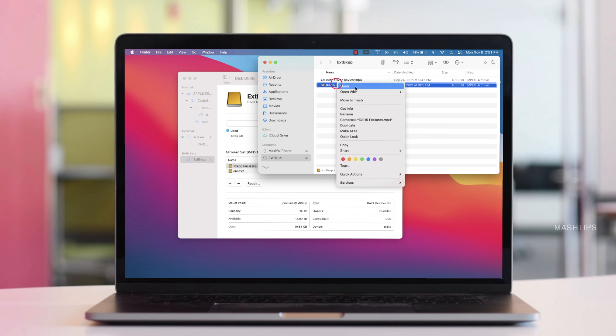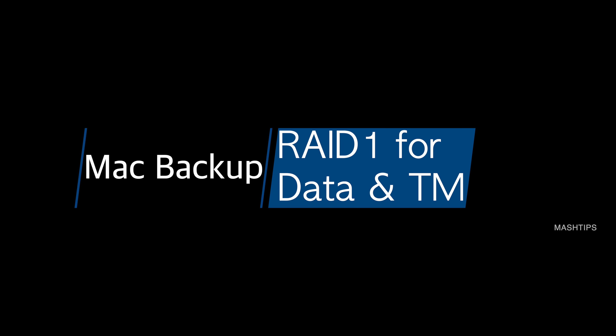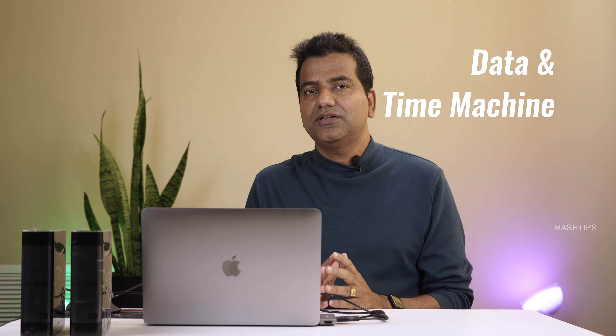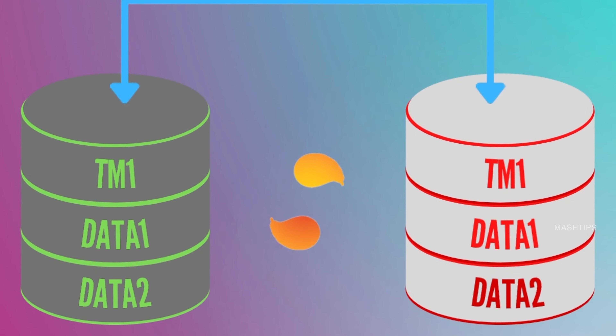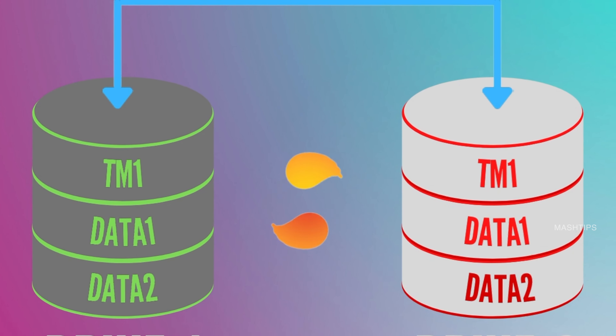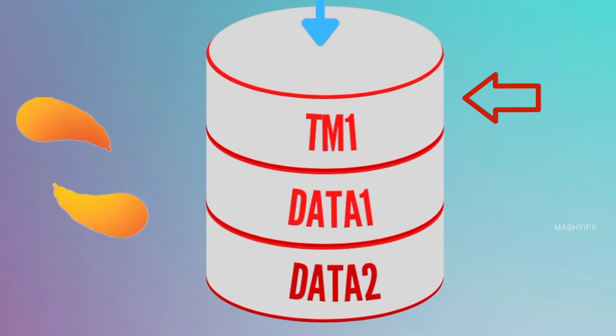Just for a demonstration, I'm going to eject one of the disks and remove one USB cable from the port. Connecting it back — let's see whether the RAID configuration pops up with just one disk. In Disk Utility, checking the RAID setup, you can see one disk is missing or damaged since we removed that USB connection. Even with only one external hard disk connected, I can still access the files copied to this external drive. So it provides some kind of protection for your files that can be used by an average user.